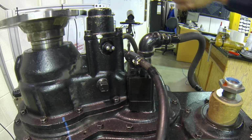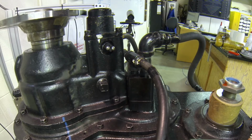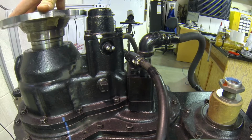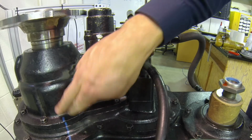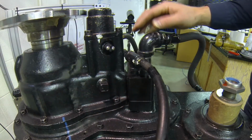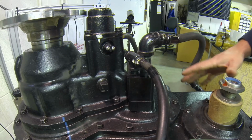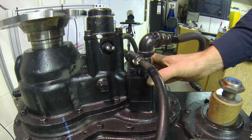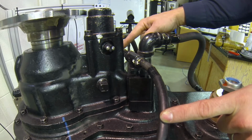So then what we can see is that we're actually making sure, if splash lube wouldn't be enough to get to the bearings of our output drives, that we're going to send pressurized oil up to our bearings and make sure that the taper bearings that are inside here supporting this high torque output are actually able to get oil up to them. So we will rely on some splash lubrication moving through the transfer case, but also pumps. And what you'll commonly see is external oil lines for any of your transfer case pumps.